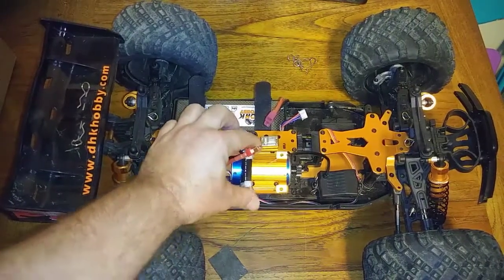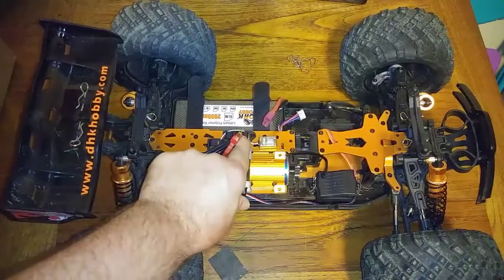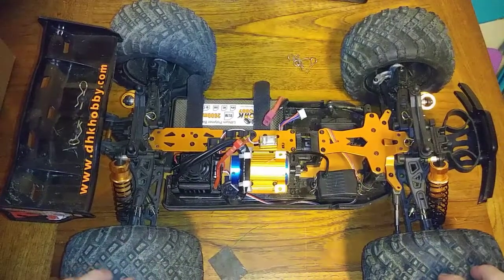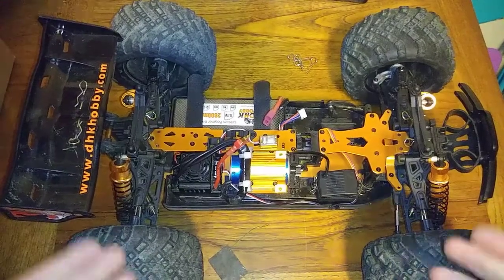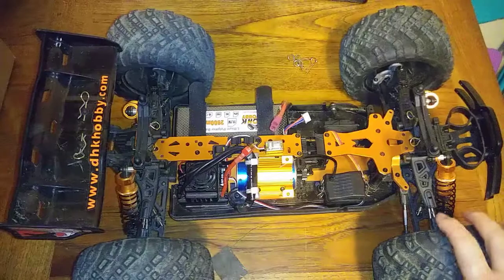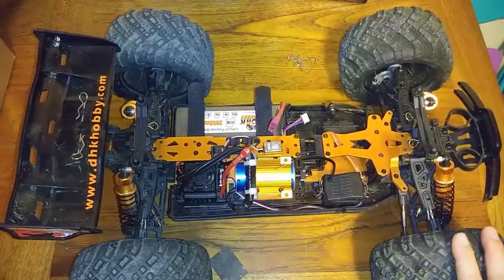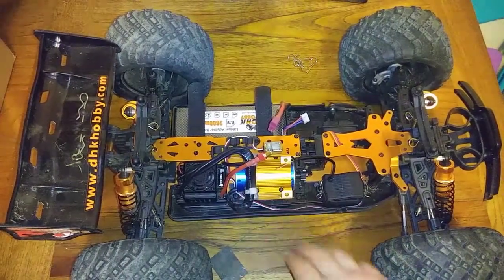I know I got them on the motor mount, but I put extra padding, extra wrap on there, and I snugged them down really good. Then I snugged everything down on this car because everything gets a little loose, and you don't know how tight they put it from the factory. I snugged down the motor mounts, everything, and went around and snugged up the little lug nuts because they seem to get a little loose after jumping and stuff. So, all right, guys, that's all I wanted to point out real quick. I cleaned that up a little bit and stopped the wires from pinching.